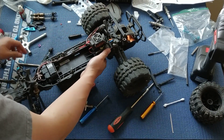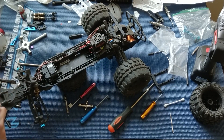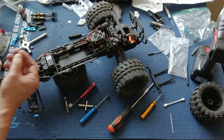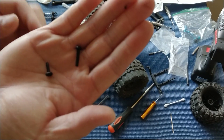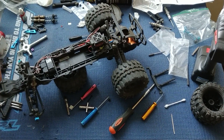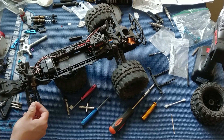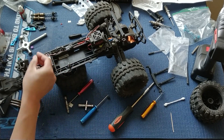So the old shock is now removed. We'll keep it together with the coarse threaded screw just in case we ever want to reuse it. We ended up going with a longer fine threaded screw, and I'll show you the difference. Looking at those two screws in comparison, you'll see a coarse thread versus a fine thread. The fine threads are beneficial because those coarse threaded screws can sometimes work themselves loose over time, even in plastic, whereas fine threaded screws usually won't come out of plastic unless that plastic has been stripped.